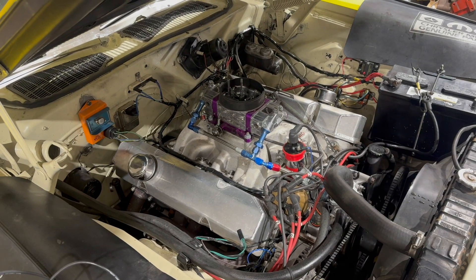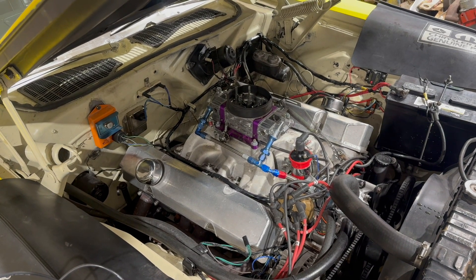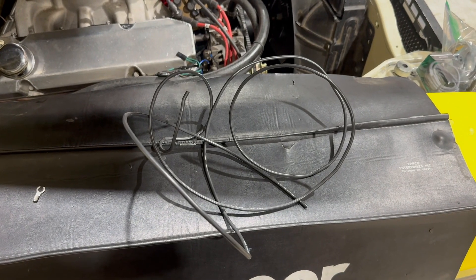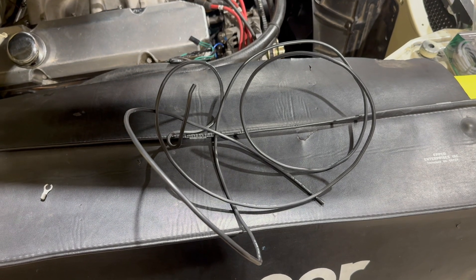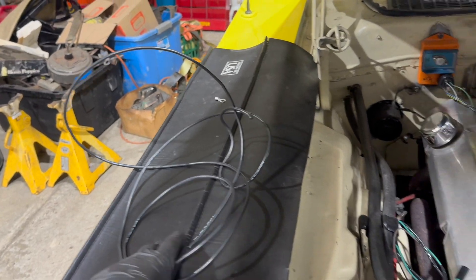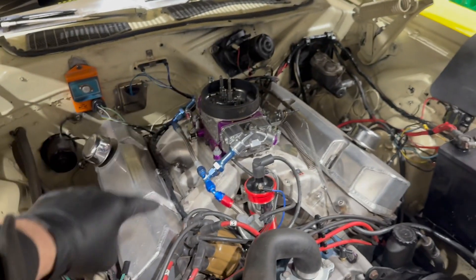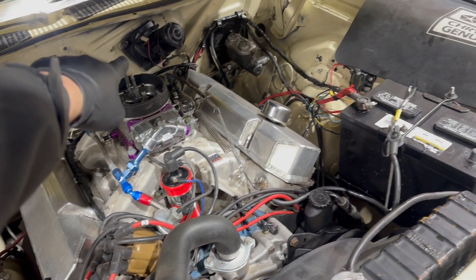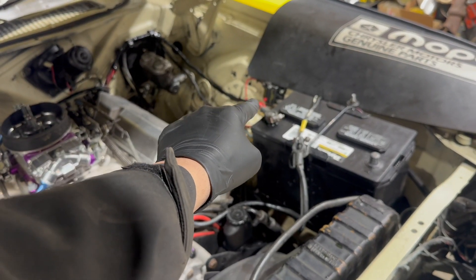The good news is there's a quick and easy way we can back up this original charging circuit and help ensure that it does not go into full meltdown anytime soon — and that is to add a charge bypass wire or a shunt wire. It's quick, it's easy, and there's really only one downside. What we're going to do is add this 10-gauge wire in parallel to the factory charge output. Instead of going through the firewall, it will run from the stud on the alternator up around the engine with the factory wiring, jump over here, and then connect to the relay behind the battery.